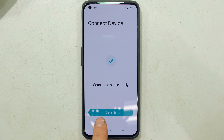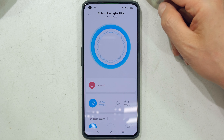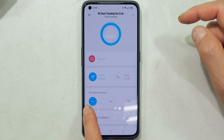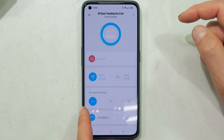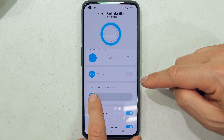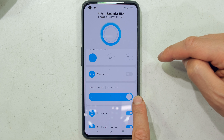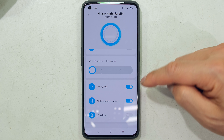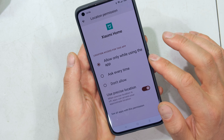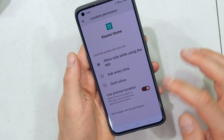It is now connected and you'll be asked to set the room. The app interface lets you turn the fan off, switch between direct breeze and sleep mode, set fan speeds one to three — note there's no graduated control on this model, only discrete steps. You can toggle oscillation, set a delayed turn-off from zero to eight hours (more fine control than the physical button), switch indicator lights off, mute the sound, and enable child lock. Getting the phone connected was easier once I enabled precise location — check that setting if you're having problems.